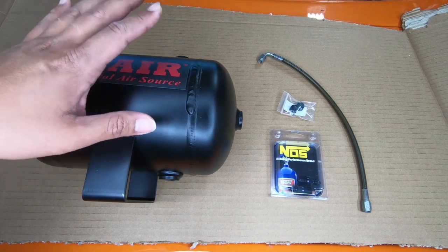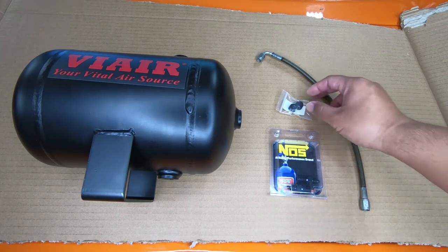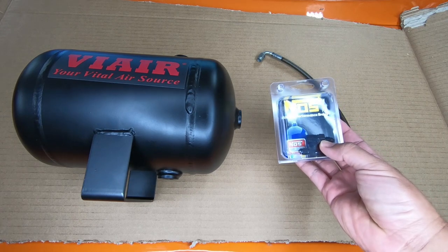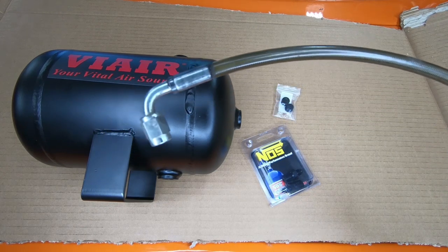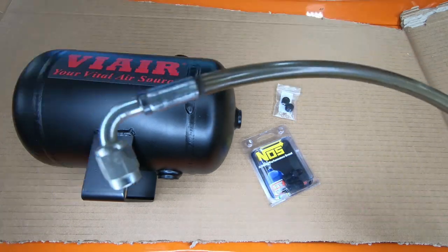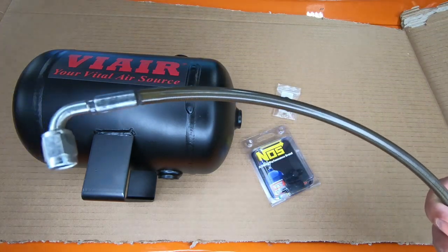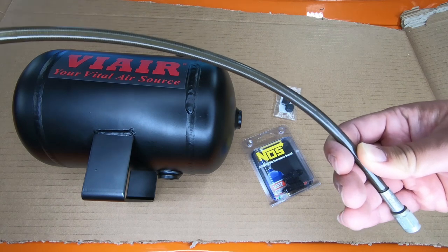Before we get started, if you're enjoying this video or you'd like to see more videos like it, don't forget to like and subscribe. Now let's put this guy into the car. For the install, obviously you'll need the tank. This specific tank comes with four ports, and out of the four, only two will be used, so we've got a couple of plugs. These adapters are quarter inch to dash three AN fitting. Last but not least, I have the air hose that's going to connect the air compressor to the tank. I'm using an old brake line I had laying around — a dash three brake line with a 90 degree at one end and a straight at the other. Depending on how you mount it and where you mount it, you might need a longer line or a different bend.